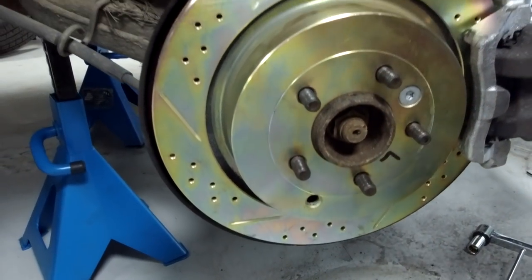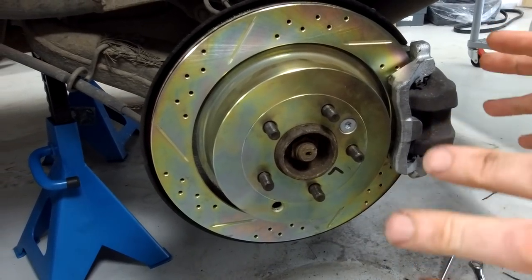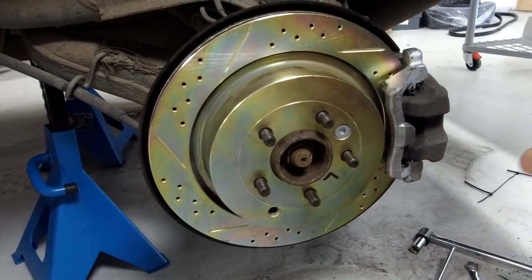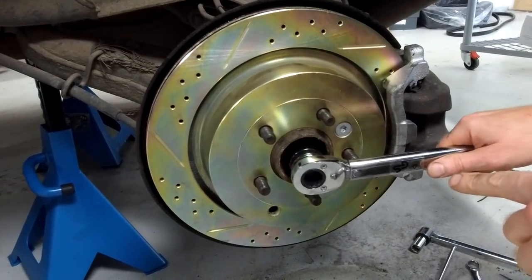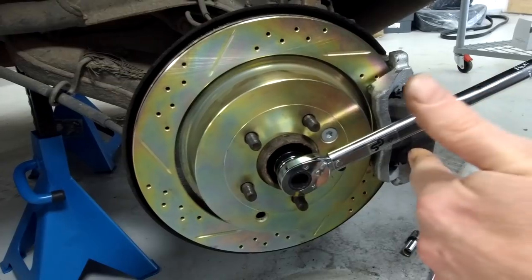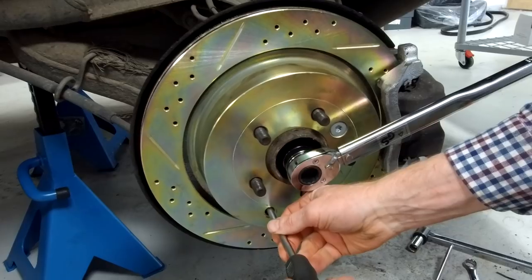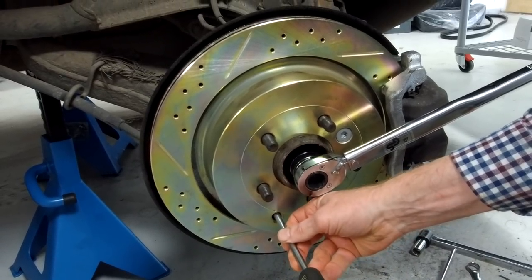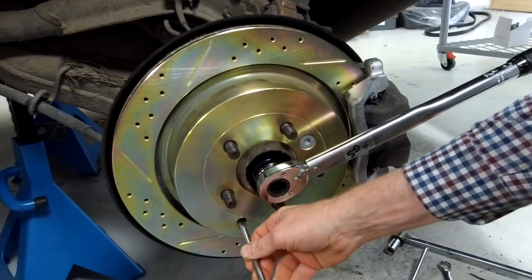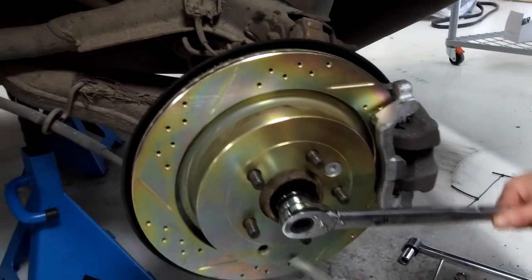Now, in the guide that someone's kindly written, I'll put the link below to the Bible. Some guy on the forums put together a Bible of brake adjustment, and it's very good. All credit to him. He says you've got to get it to a certain torque level where you put a torque on and you can still move it. But what I think you'll always find is you just go as tight as you can and you back off one notch. So if I back it off a notch, then it'll go forward.